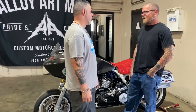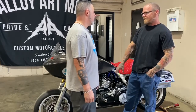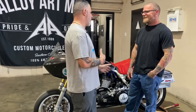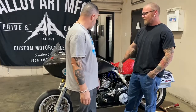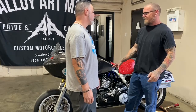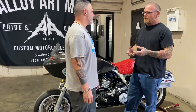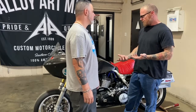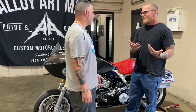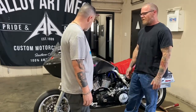This bike's done really well, all things considered. The cylinder design helps keep the combustion chamber temps down and keeps the cylinder itself cooler than a stock design does. When those came out, a lot of people were instantly like, don't you need more fins to keep it cool? No — you actually have more surface area to dissipate the heat. The biggest difference is that cylinder actually ends up being an active cooling system when the motorcycle's in motion. The air passing over the cylinder becomes turbulent, and turbulent air extracts the heat out of the base material. Whereas with a traditional design, the cylinders dissipate heat and the air passing by is simply pushing away dissipated heat. It's basically just the product of an airflow study that I converted into a motorcycle cylinder.